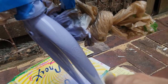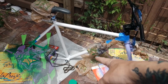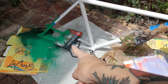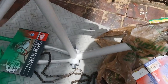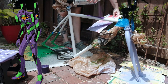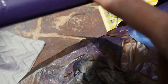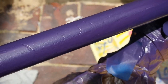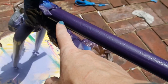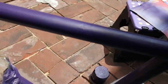See how the paint is kind of chunky — I'll have to sand that down and redo it. Most of the body will be dark purple and then I can go in with detail in other colors, so the purple would be the base. I do want black along here and I'm running out of black, but it should be okay. I don't know if you can see that, but see how the paint is like curdling? This isn't from the texture of the bike — maybe this is from being in the direct sun. It's curdling almost. I'm going to have to sand all of that too. And down here it's not showing up gloss — it's showing up matte, which I think is probably because I didn't shake the can long enough.